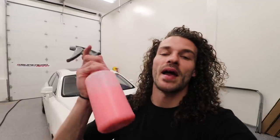Now that we've blown the majority of the water off, here's a special trick: I take my spray wax or detail spray and mist down the entire car. I do this for two reasons. First, there may be dirt I missed — and if there's a detail spray or spray wax on the paint it makes the towel and paint surface more slick, so less chance of scratching. Second, it helps with drying because this spray wax is hydrophobic, it beads up the water nicely, and once done drying it leaves a waxy layer on the car.